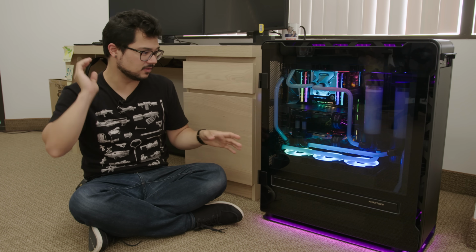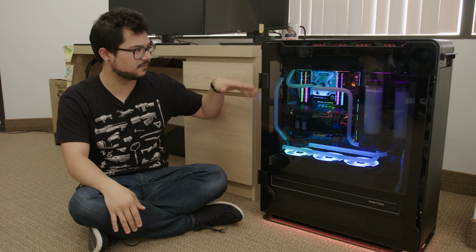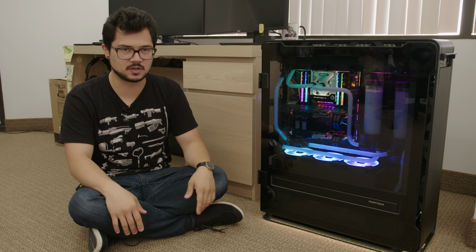Unfortunately, there's no way for me to access that SSD without draining and disassembling the entire loop because it's mounted to the motherboard underneath the motherboard's shield or whatever. It's a giant plate that's being covered up by the graphics cards, and obviously you'd need to tear down the loop in order to remove those. So all right, well, I was hoping it wouldn't come to this, but it looks like I'm gonna have to drain the loop after all if I wanna take a closer look at the drive and perhaps troubleshoot the CPU.